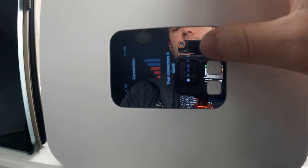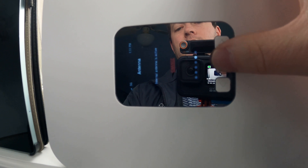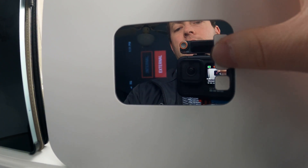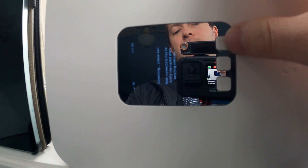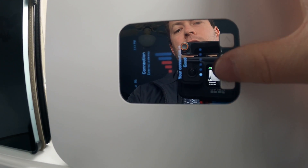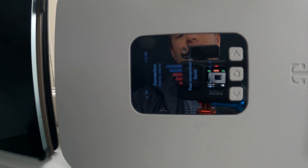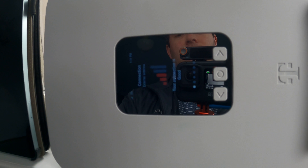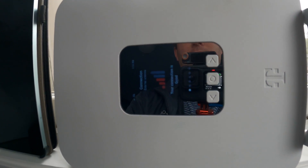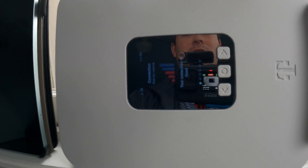So this is the internal antenna — you can see it says three bars. But I can scroll over and get to the antenna and change it to external now that I have the Quad Mini hooked up, and we can just see if it shows any difference. At least right now, it shows external, but no change in signal. That's where the bars really don't matter — we've got to look at the metrics and, most importantly, the speed that it gives us.